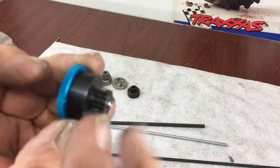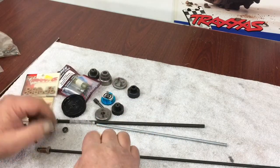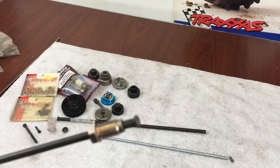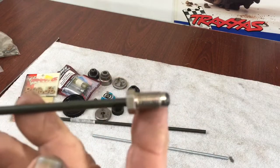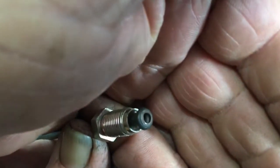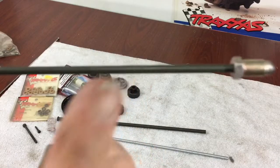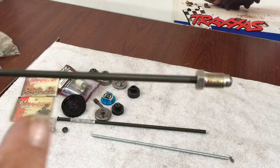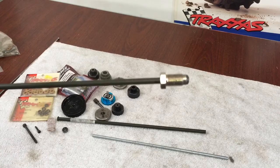Here's what I did — and I know it's going to sound cornball, but sometimes you've got to do things by the seat of your pants. This is three-sixteenths brake tubing for a European car — you can see the bubble end on it; the newer metric ones have a bubble on the end. You go out and buy a piece of this. I got mine from NAPA and I'll show you the part number and sizes.